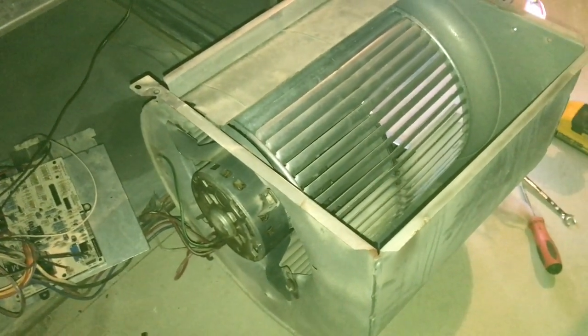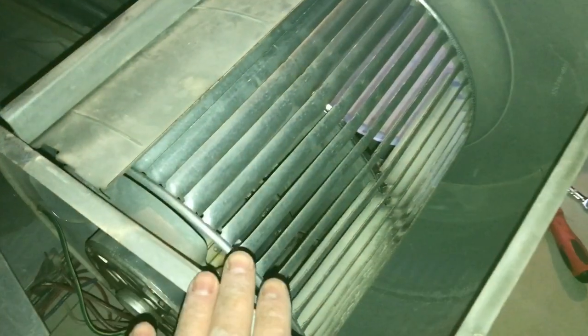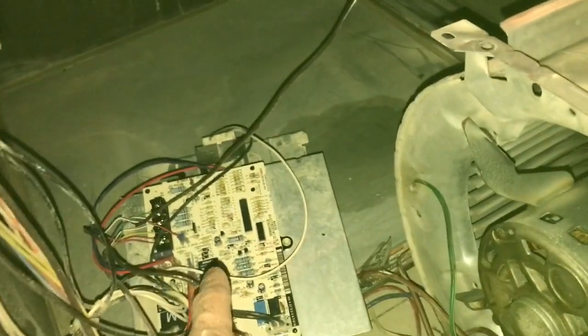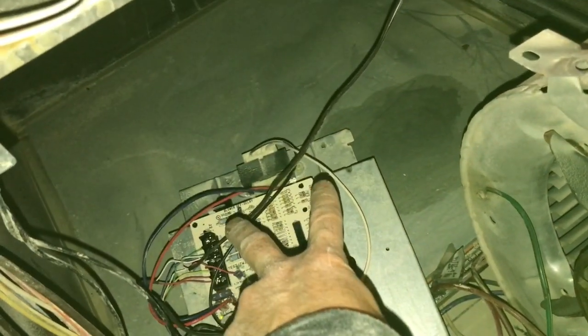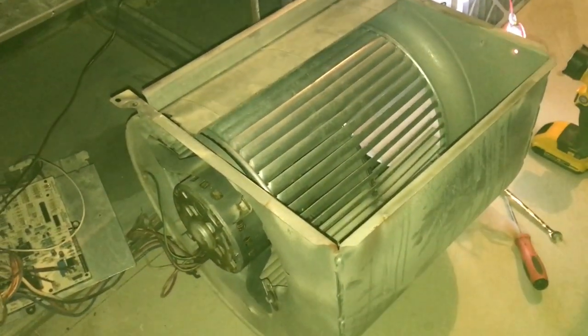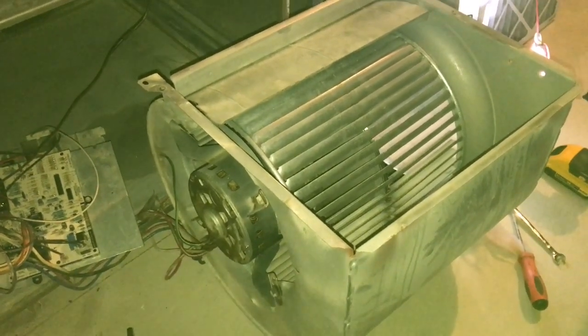I hope this video helps you on replacing your assembly. When you get this out, it was real simple for me — every unit might be different, but all I had was two screws and it was hanging up inside. Taking those two screws out, the entire assembly just slid right out. But before doing so I had to remove the motherboard, which also had two screws on it hanging right in front. I removed those two screws, then the other two screws, and it slid right out. If this video helps you out, all I ask is a thumbs up — thanks for watching.